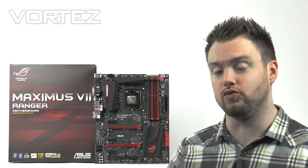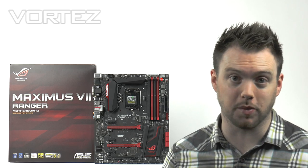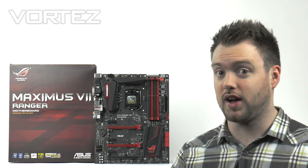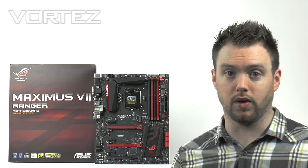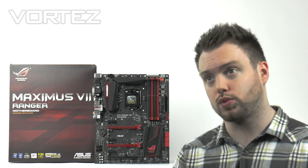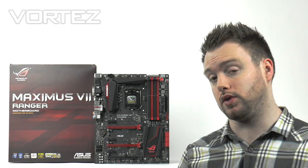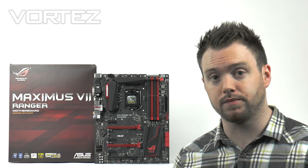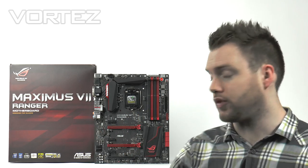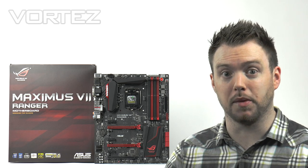That concludes our look at the new Maximus 7 Ranger. It's one of my top picks simply because it crams so many decent features in at just £130, getting you into a Republic of Gamers board with great performance. The only drawback with Z97 boards right now — as of May 2014 — is that the best available chip is the 4770K, with the Haswell Refresh not quite ready and the fifth generation even further away. Z97 is really aimed at those still on Sandy Bridge or Ivy Bridge needing an upgrade path, or those wanting to get ready for the new kit coming very soon. Head over to the link in the description for the actual performance review.